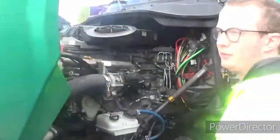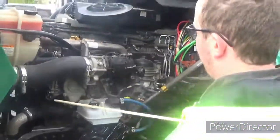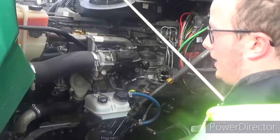Now the driver side — you want to start with the same thing: the general hoses on the driver's side. Once again, anything that's a hose, you check it. Properly mounted and secured at both ends. No abrasions, bulges, or cuts, and not leaking.